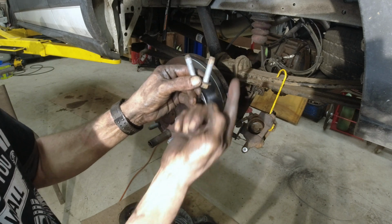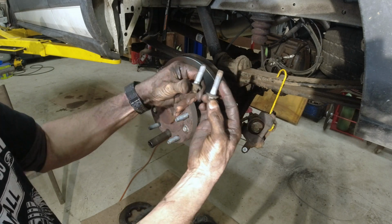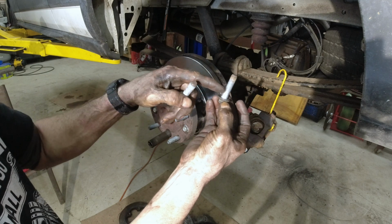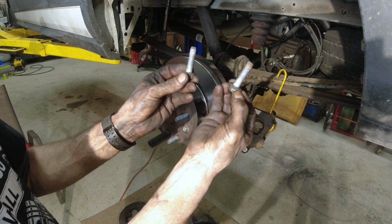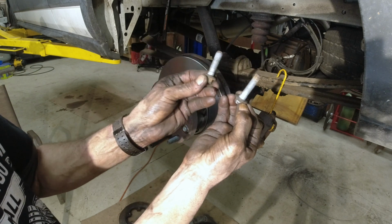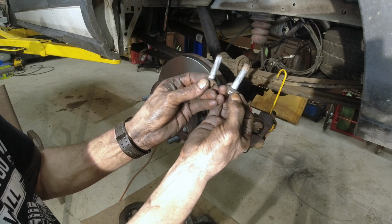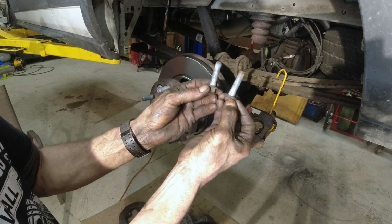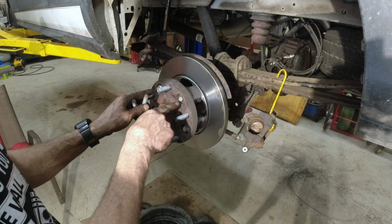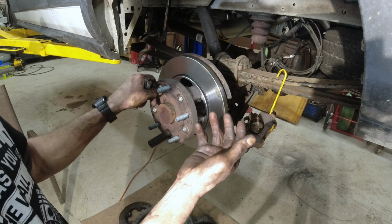Okay? You torque them down 100 foot-pounds. Which one actually got the bolt stretched more? It's going to be this one. Shiny, oil, so it stretched the bolt. This one technically got torqued more than this one, even though we torqued them both to 100 foot-pounds. So when engineers figured out that, hey, the better way to do it is they tell you, put these at 35 foot-pounds, which is basically nothing.